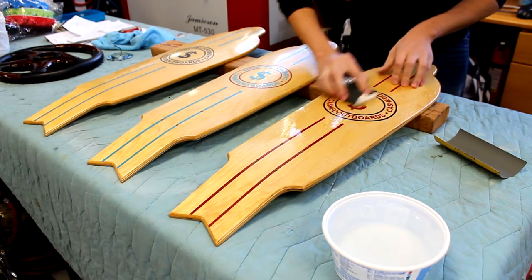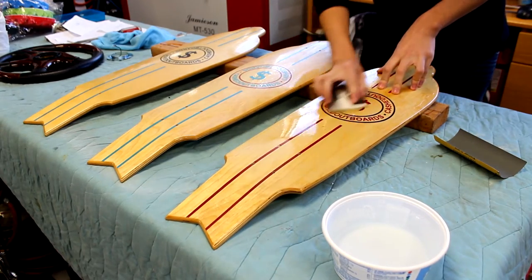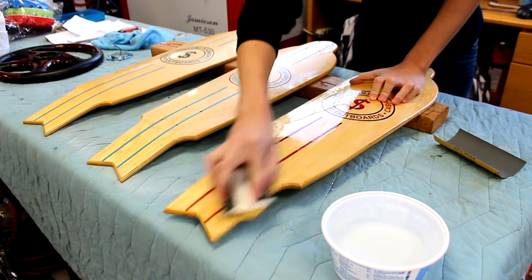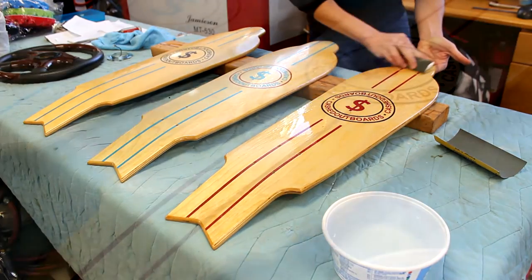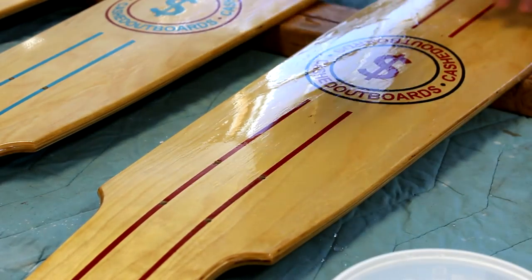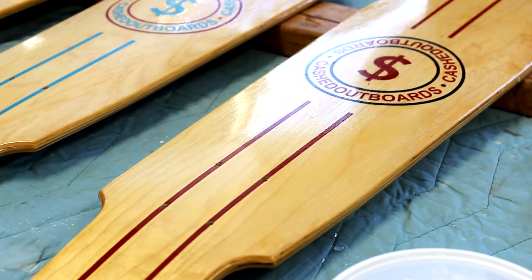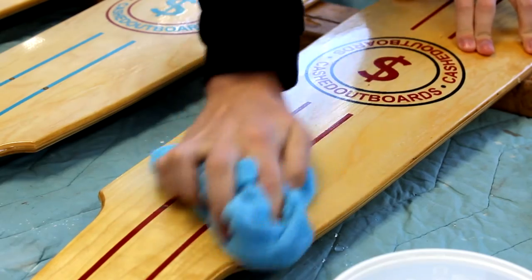You really don't need a lot of pressure because you're not trying to go through the clear coat — if you do go through it, you really have to start the whole clear coating process again. So just go light pressure, just enough to pull up anything that's in the coat and really smooth it out. To check your progress, I just like to take a microfiber and wipe it down and try to dry off the surface. You're going to want to wet sand until you have a pretty uniform haze across the whole surface.